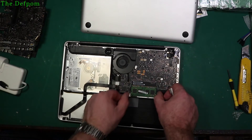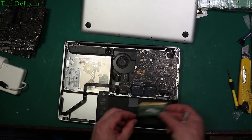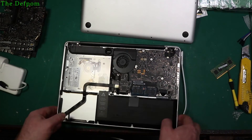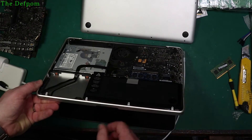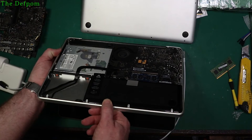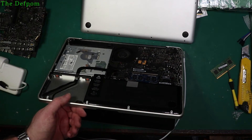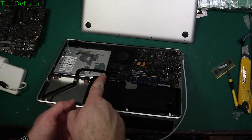Could still be a RAM issue, it is mismatched. Let's take one out, down to a single DIMM now. I've unplugged the battery as well, just a little bit like that. This is different — it's spinning slower.